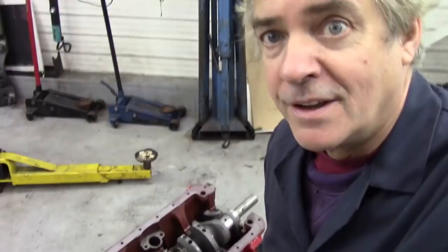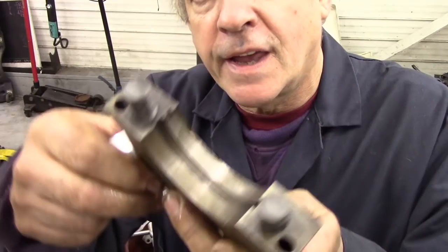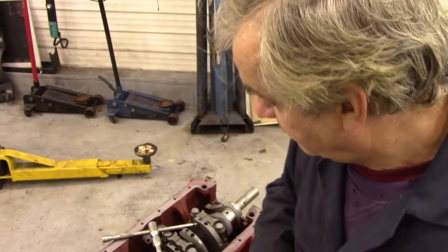There should be an arrow on here. Now we're going to fit the bearing caps. I've already pre-fitted the bearings. We're going to put the caps down and snug them down, but not torque them down yet, because we need to do a very crucial measurement. Just before I fit the number one cap, I'll show you the actual bearing cap itself. Notice there's a groove that goes around here — that's why the shells have got holes in, so oil can get all the way around these very crucial parts. You don't want to rely on oil only coming through the top of the shell; this allows it to go all the way through. Surface area is reduced a little bit but lubrication is improved a great deal.